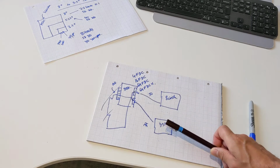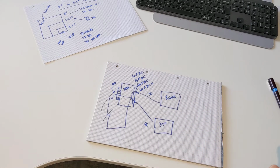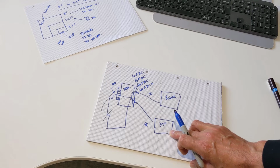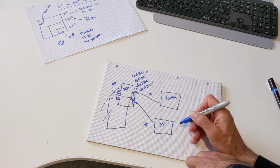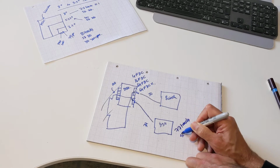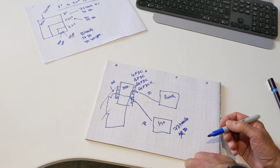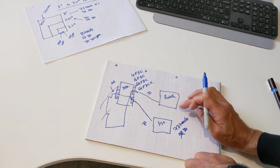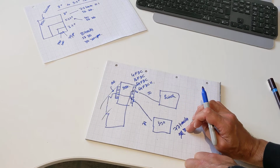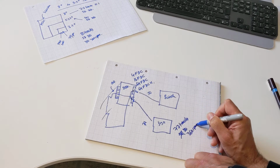So painstakingly, we could take a blank 3.5-inch diskette, format it at 360 RPM, so that when this drive is being emulated in the Cromemco system, it will only have 77 tracks. You can have single density or double density, but why would you ever want single density? So I think I didn't bother converting. If I had an original at single density, I think the target would end up as double density, because why not? And then it would also be spinning at 360 RPM.